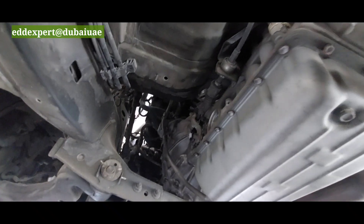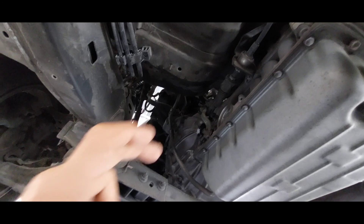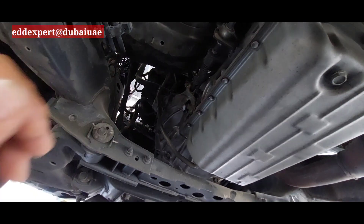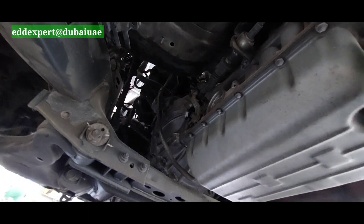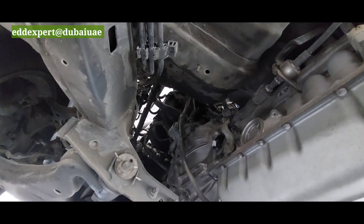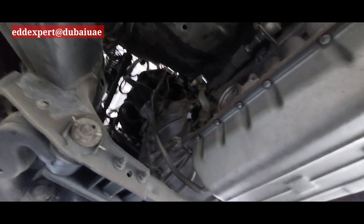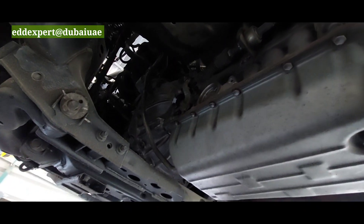the level of the ATF should go down to the correct level when the engine is started, but it doesn't. So that is 100% a torque converter problem — that is the cause of the slipping. There is no problem on the clutches or anything else. Only the torque converter. I'm 100% sure — that is my diagnosis based on my experience.